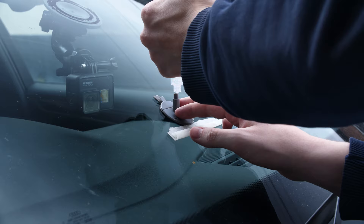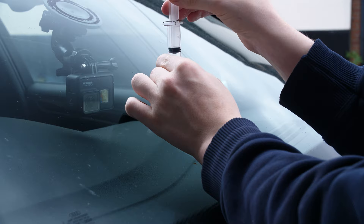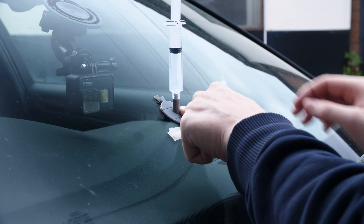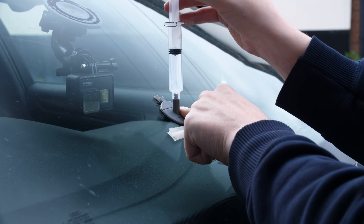Once it's been 10 to 15 minutes, you can then take the syringe off, put it straight back on with the plunger up and push the plunger down to its second locking position, which will put a little bit of pressure inside the chamber and help force the resin and compact it down into the chip. I had a little bit of a pressure issue and so quite a lot of the resin did end up leaking out.